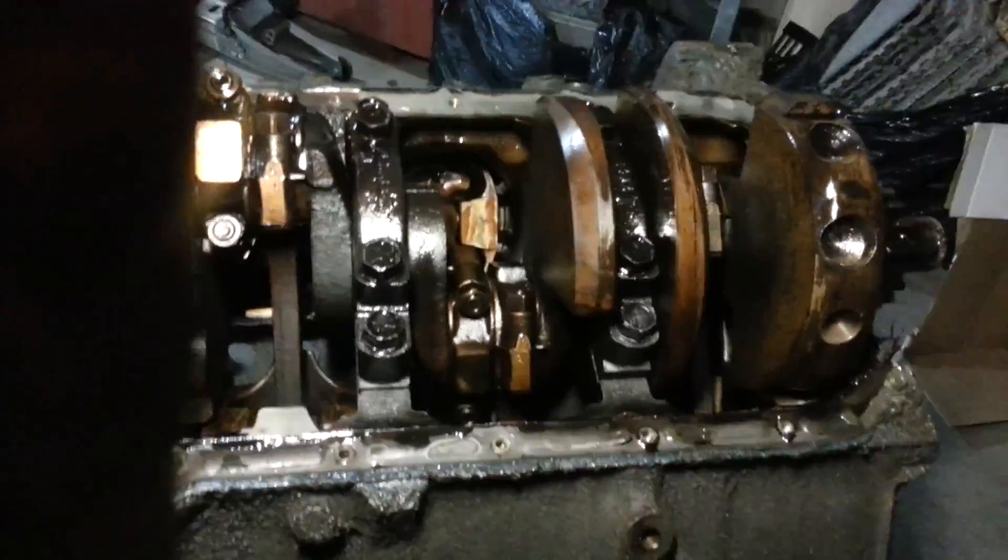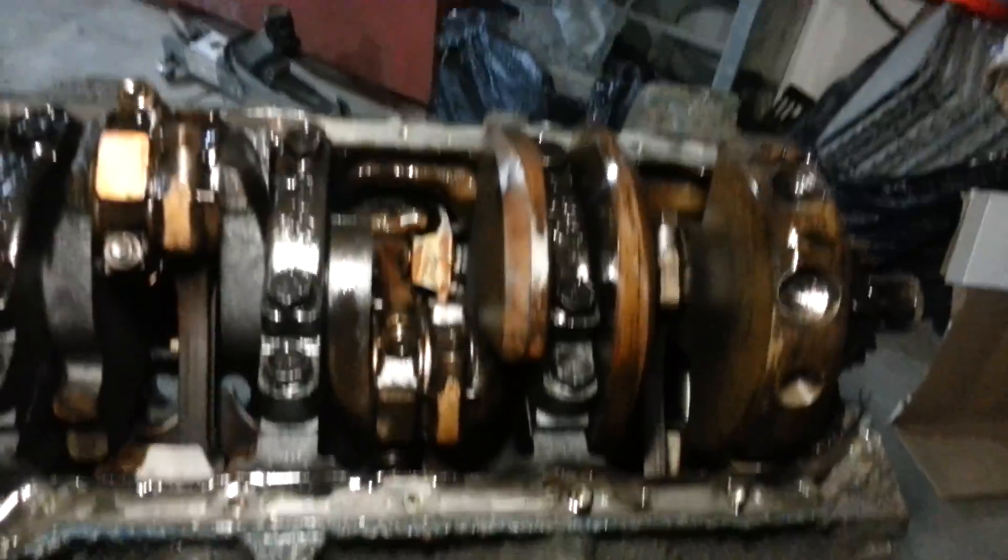That is not good. Anyway, back to this knock — I had a really bad lower end knock, almost like a pounding, definitely not a tick. So I tore it down. What you want to do is wiggle your connecting rods back and forth. All of them seem tight except one — and that's what you would hear. That's just how it sounded when it was running. Real bad.